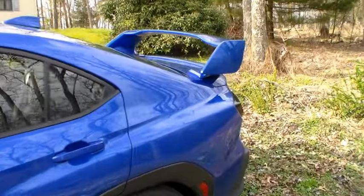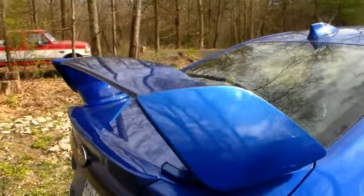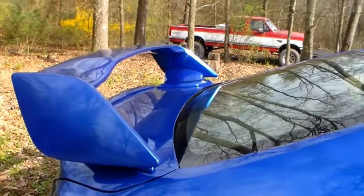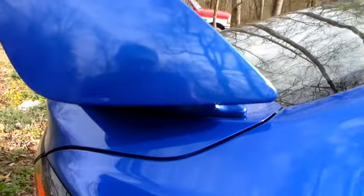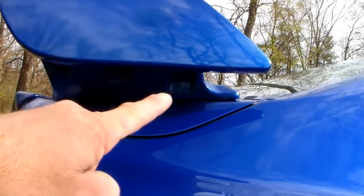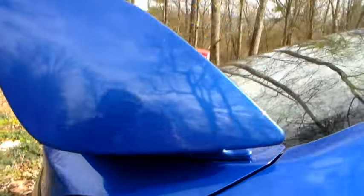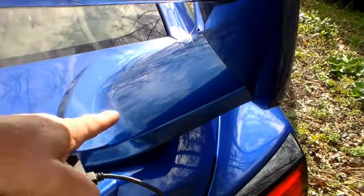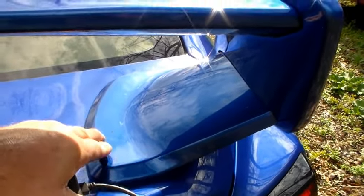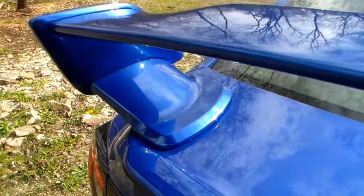I want to do a quick walk around and let you know — after installing this, we took it to the car wash and hit it with high pressure soap and water from every direction and it did not leak. Just so you know: a lot of install videos make it look seamless, but if you see the foam tape visible a little bit, that is normal — you don't notice it until you're up close. We have this bolted down tight and it held through high pressure washing. If I had to do this again, I'd put some silicone caulk around the screw holes before bolting the wing down as an extra measure of waterproofing and added hold.